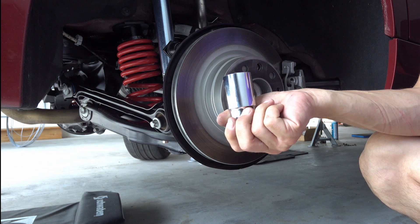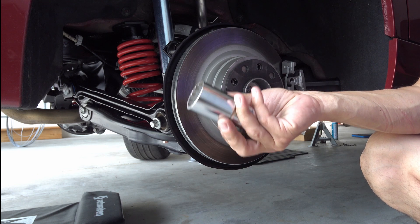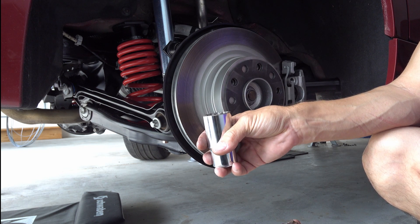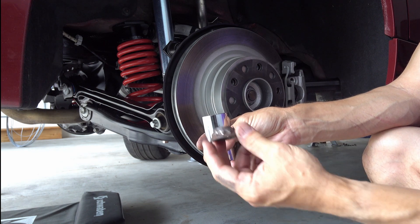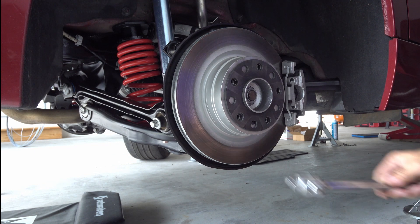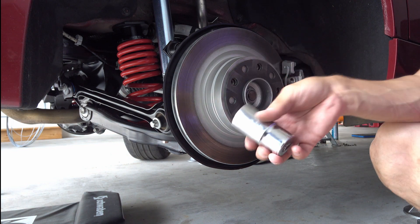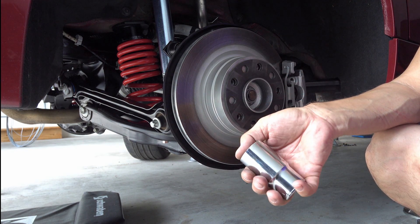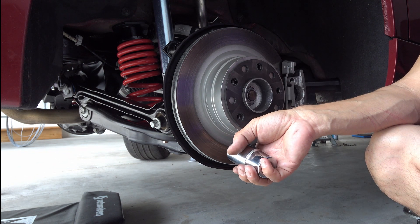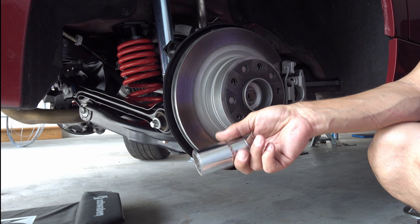Impact grade is the best to go with because you will have to use an impact wrench — nothing else will really do the job with rusted nuts. You can try a breaker bar — something like a half-inch square — but that will be a struggle. My advice is to get a really good impact wrench.